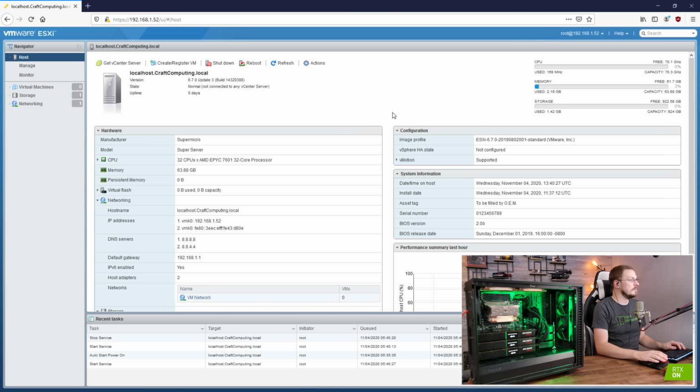We're going to run the MXGPU script one more time just to make sure that all of the GPUs are installed and seen by the system. So we're going to type in sh, then mxgpu-install.sh, and then -a. Then inside of here, we're going to type in list. And there you can see all six of my graphics cards, all six S7150s, because there's two S7150s per card. And if that looks good, I think we are ready to start building our VMs.